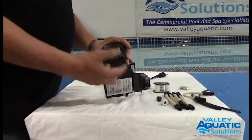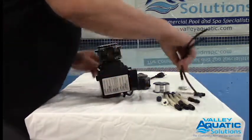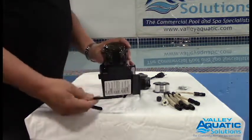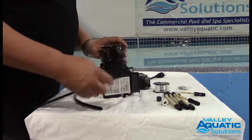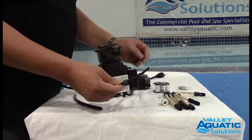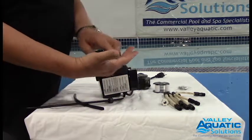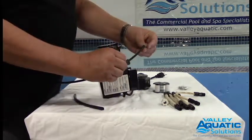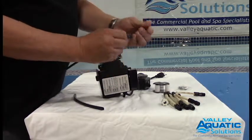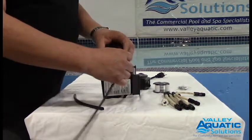To change the feed tube, you will have to take your tubing off. You can install quarter-inch or three-eighths tubing on the pump. If I'm going to put quarter-inch tubing, which I prefer because I need no special adapters, all I have to do is put a connecting nut on the tubing. And you always want to use a fresh ferrule. The ferrules are almost shaped like an arrowhead. That head part I want to go upward on the tubing, and that head actually slides into the bottom of the feed tube to seal.